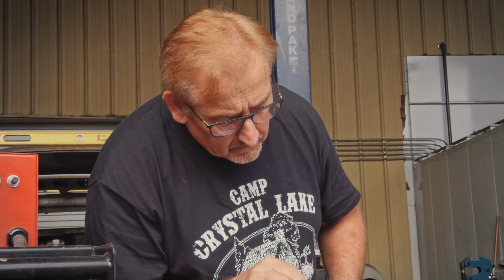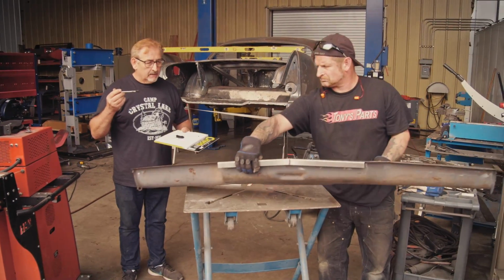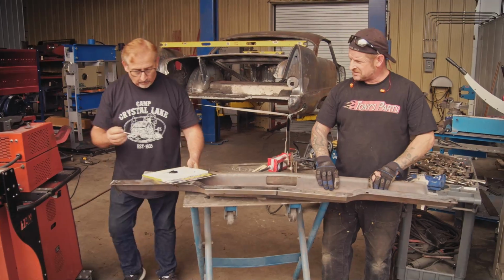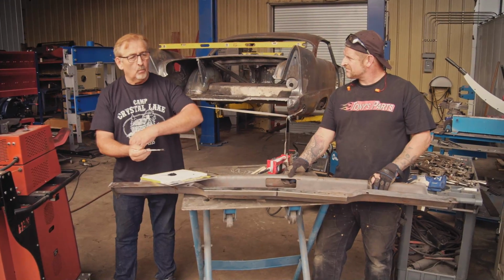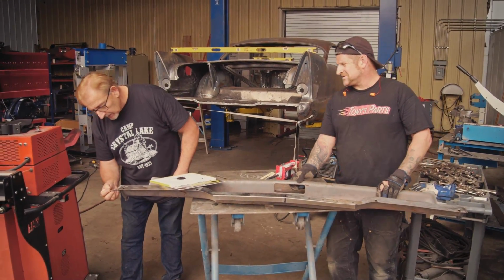How long has panel bond been around, boss? It's used a lot in the OEM world, so manufacturers use it, and it's used a lot in the collision world. I was using it back in the collision days back in the late 90s, and I imagine it was around before that. Handy stuff, isn't it? They use this very same product to glue quarter panels on cars in the factory and bedsides. Yeah, and when you see crash tests with this stuff, the car will just be a wadded up mess and that panel will not break loose, period. Amazing stuff. Yeah, it is.